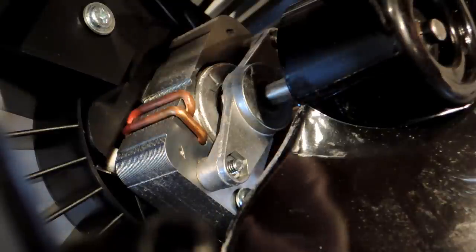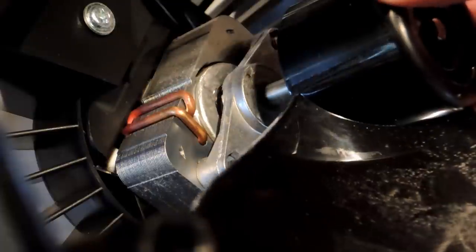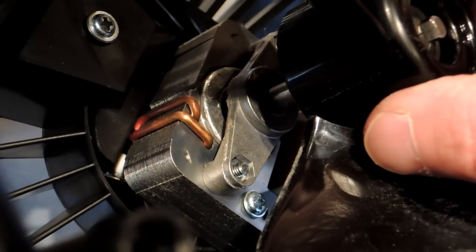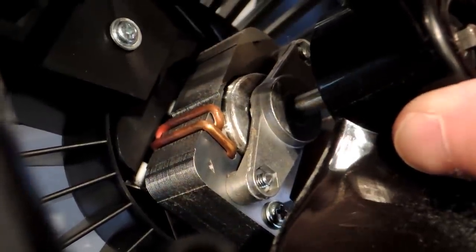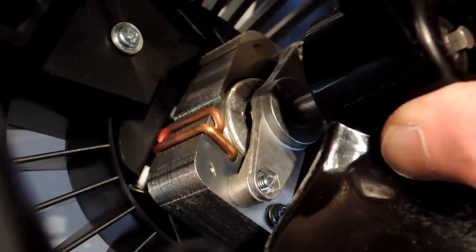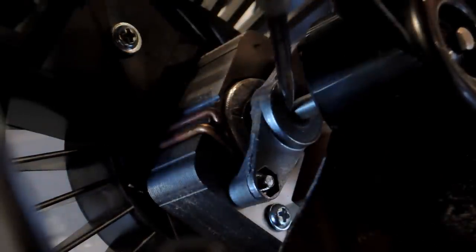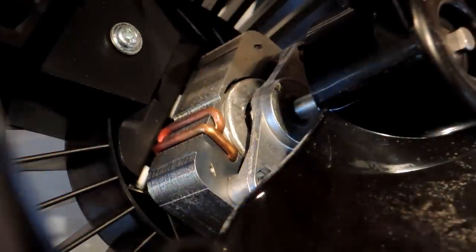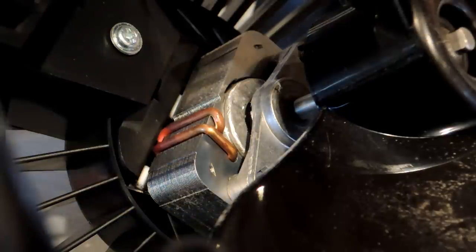Here's a close-up of the fan — you can see the fan blade spinning right now. What's happened is the bushing has just worn out or become very dry. See how much that armature moves back and forth? That's fairly normal, but the more it wears the more it'll move. Right down here is the main bushing — that's where you need to get lubrication. There's another one on the bottom but this top one is the critical one. You could use WD-40 but it's a really lightweight oil that will evaporate quickly and won't last.